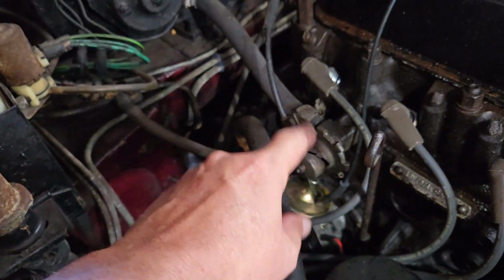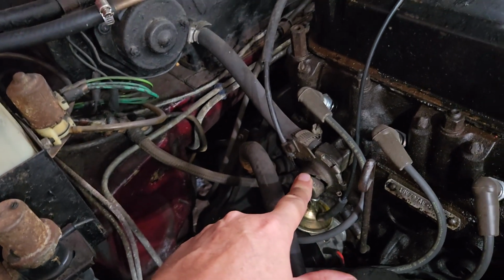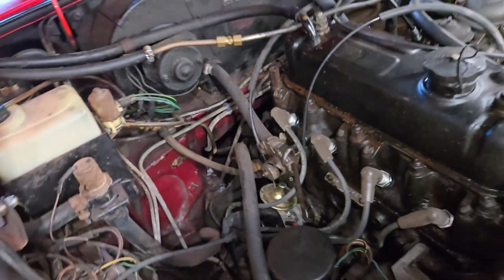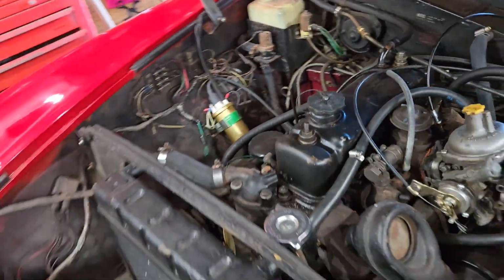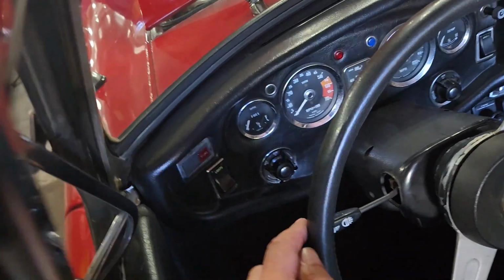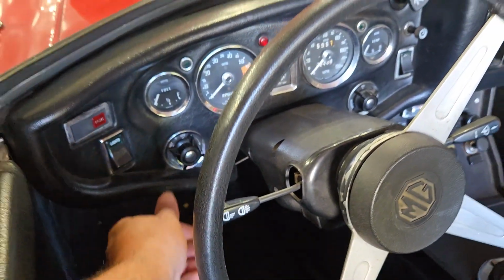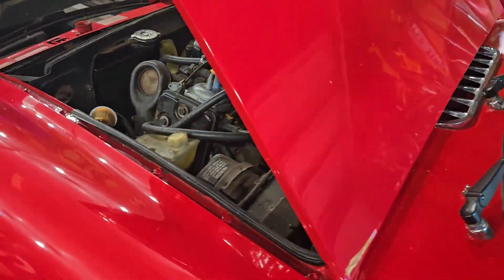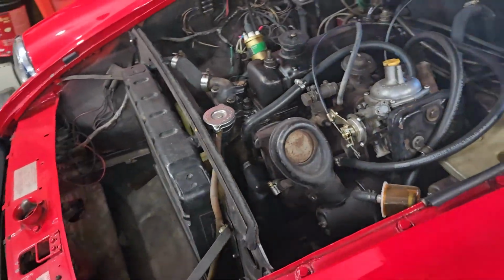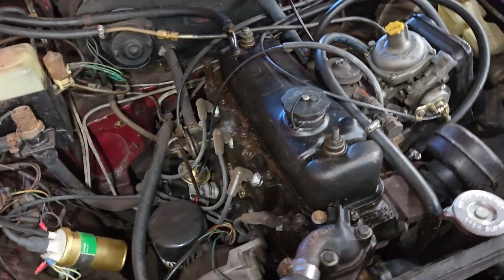So early in the year when she drove it, it was a hair chilly out and she turned the heat on. This is actually the heat control valve that allows the hot coolant into the heater core inside. It's actually controlled by this knob right here. So once she turned this, I'm guessing that it hadn't been used for a very long time, and that is what has caused this to leak now, because the diaphragm probably got put into a different position.